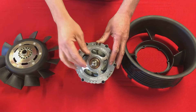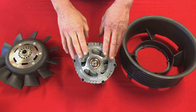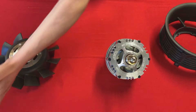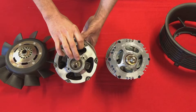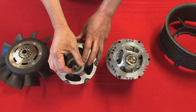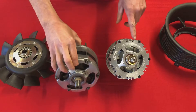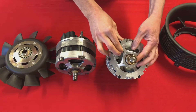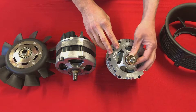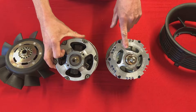One of the advantages of having six phases instead of three is that the output is greatly improved at low RPM. To give you some comparison: the top-of-the-range 3.2 alternator unit is rated 90 amps but can only produce between 35 and 40 amps at idle. This alternator is rated at 175 amps but can produce 75 amps at idle. So the biggest difference is 35 amps versus 75 amps at idle speed.